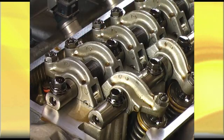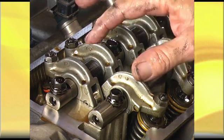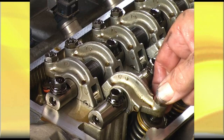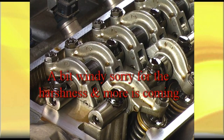Now that we've got number one cylinder rocking, that means number one isn't on compression. Which cylinder is about to fire? It's number four — that's why we're setting the tappets on them. Because the tappets should be totally loose: both valves closed, it's ready to fire that spark plug. So that's the zone that we're going to adjust.